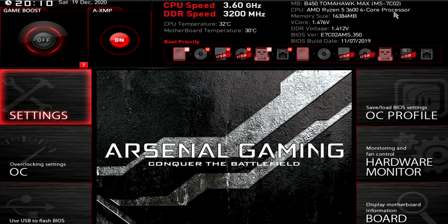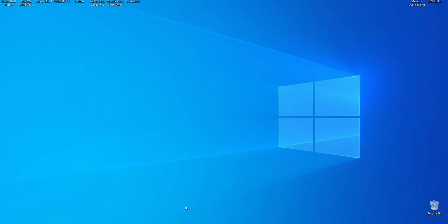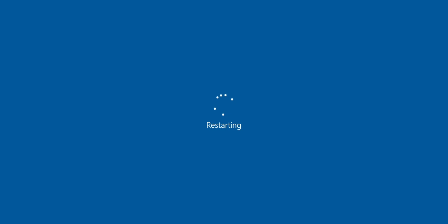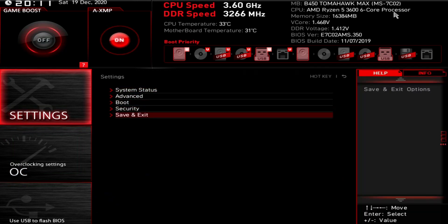After you've changed your FCLK frequency and your DRAM frequency, go ahead and save and exit. This time, let it boot to your OS, mess around with some stuff, make sure everything's running fine and that it fully posts without any weird issues. Once you verify that it looks fine, restart your PC and jump back into your BIOS. You're going to want to bump up your frequencies again and rinse and repeat until you have some sort of post issues or you hit 3800 megahertz on your DRAM frequency.